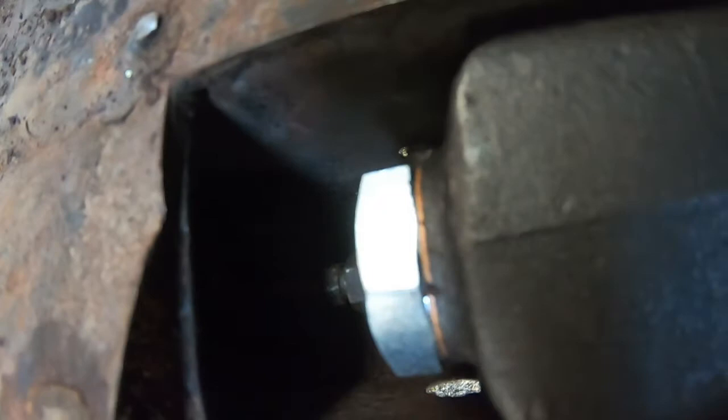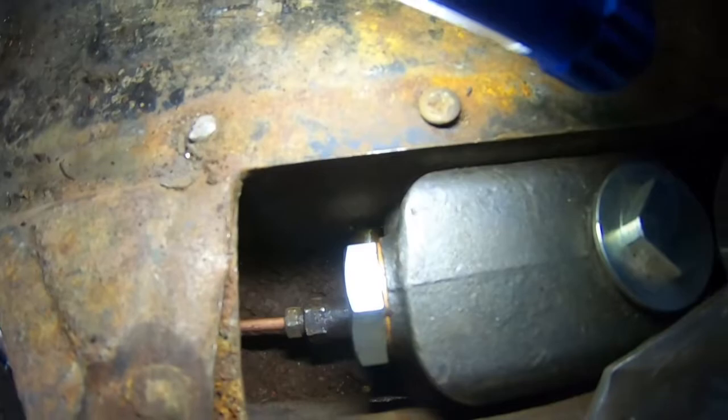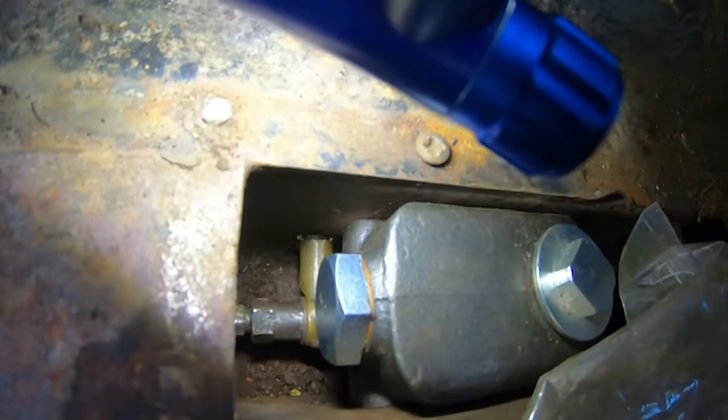Let's grab the light. It's starting to get a bit dark now. There you go, you can see it's in, tightened up, hopefully tight enough. The front one on the banjo there is all tightened up, and if I crawl around on the floor again, you can see the brake pipe is routed. Now, the tabs, you can see that one's quite a good example. The pipe goes underneath them and they sort of fold under. There we go, like that.